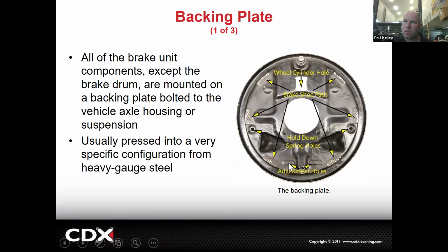Additionally, if you look, this has knockouts. They're made of metal, but they're just held on by a little tack weld. You can smack that with your chisel. You'd never use a flathead screwdriver and a hammer, would you? You can knock those out, and then you can do your adjustment with the drum on, and that's the best way to fine-tune an adjustment. But if you don't recognize it as a knockout, you'll say there's no hole, that you can't adjust it like that, until someone with more experience comes over and says, oh, that's a knockout. Put your screwdriver up there and smack it, and chong, it comes out.